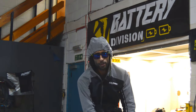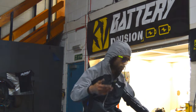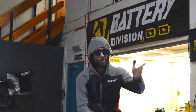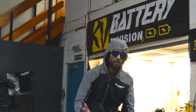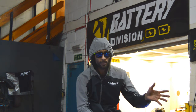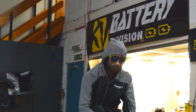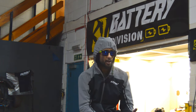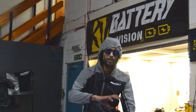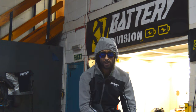So I don't know how to call this one. It's kind of a 50-50 win-loss situation. There was a point where the Fardriver wasn't wanting to work. I contacted the guy who created the encoder to Hall sensor converter, and he let me know that the converter may need some calibrating. So we may need to run the motor for several cycles just to get it calibrated, which left us in a bit of a catch-22 situation because the Fardriver isn't gonna allow the motor to spin until the Hall sensors are calibrated.